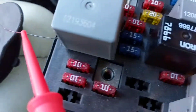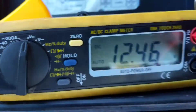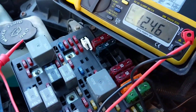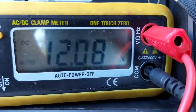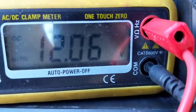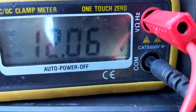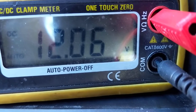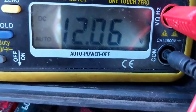I'm at the B+ side — that's the B+ side — and it reads 12.46. Now the headlamps are on. Look how much it dropped: it was 12.46, and now it's dropped to 12.06. What does that mean? That means current is flowing through that load circuit through the headlamps, and that's why it drained — it brought down the 12.4. Let's go to the other side, the output of it, and measure it. Before, we had zero, because the switch was inactive.